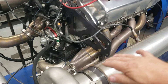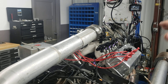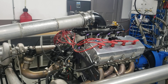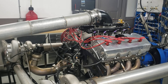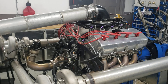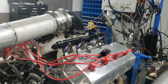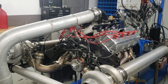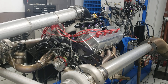We're going to go do a Q16 tune since it's intercooled. This is his whole hot side — this is actually where the turbo mounts in the car, just not the intercooler. He has an intercooler that must be in the cab because the throttle body is normally turned around backwards. What we're going to do is a guessing competition. I just finished up the pump gas tune — 17 psi, a nice easy safe number. This makes more than the number he's looking for on pump gas. So give me your best guess on horsepower, and then we're going to do the Q16 tune on 30 psi of boost. So: 528 Hemi, Q16, 30 psi — give me your best guess.